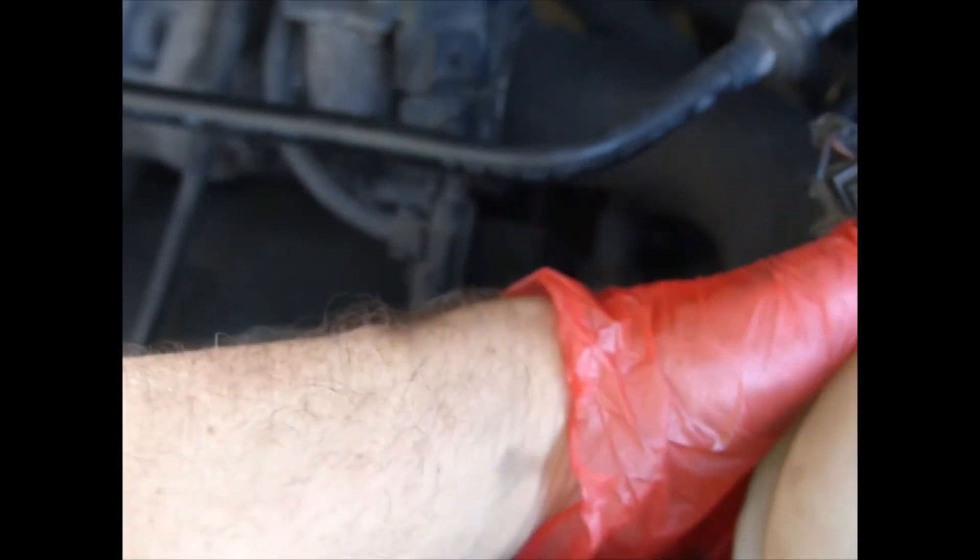I've lost a bit of tissue down there — sometimes you need skinny arms with eyeballs on the end of your arms. Anyway, that's the fuel filter done. You need to put the coolant tank back in place, then check the oil if it's all come out the bottom, put something back in, and then refill.